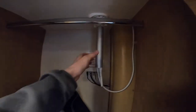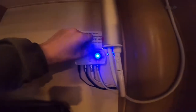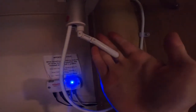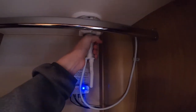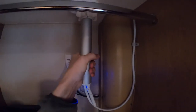In the wardrobe is where you'll find the location of your TV aerial. You've got your Vision Plus booster at the back, so you can boost or weaken the signal should it be too strong or too weak. With the aerial, if you are struggling, release the nut here, push the stem up and then use the little toggle to direct the aerial. Look at where your other motorhomes and caravans are pointing — that's the best advice I can give you — point yours in a similar direction and you should get a good enough signal without messing on for too long. Before travelling, always pull it in and tighten the nut so that the aerial doesn't catch the wind and get ripped off the roof of the vehicle.